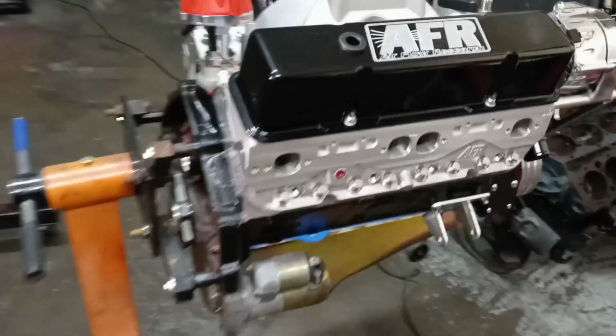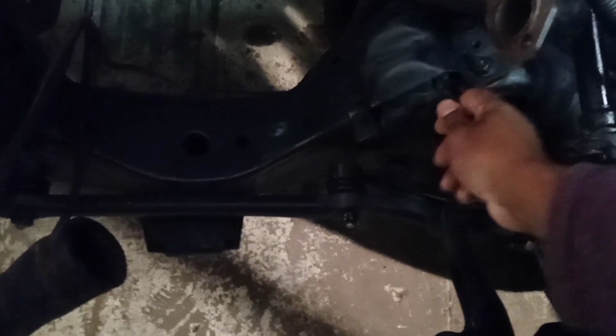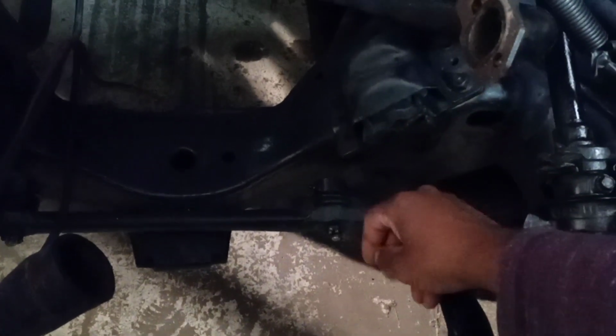So we're finna go ahead and get this flywheel on this small block. Put the flywheel on, put the converter in, and I gotta change these frame mounts out to some steel mounts. You don't want these when you plan on putting that power in there. When I took the old motor out, I discovered this one already ain't no good, so that's just a problem waiting to happen. Try to reuse that. Other than that, that's it.